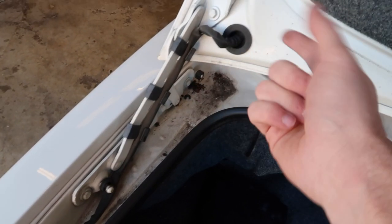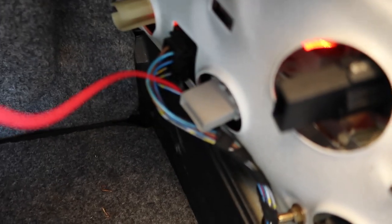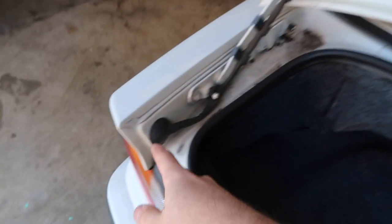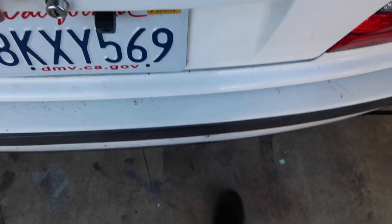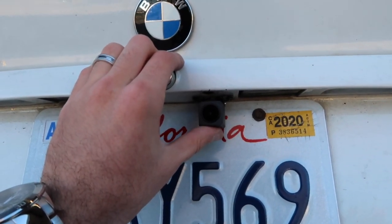I'm fine with one wire sticking like that — it's not too noticeable. This red wire is the reverse light cable, so you've got to tap this into a reverse light. I tapped into the reverse light back here, so the wiring is pretty much done. It's all routed. I'm going to reclip things up here and just test out the camera. We got the reverse camera on there too. I'm going to go ahead and tighten this down — right there is a good angle. Let's go ahead and test out the camera.